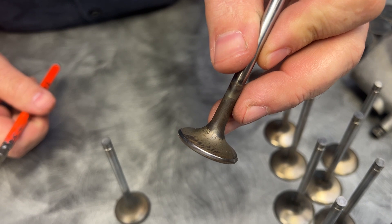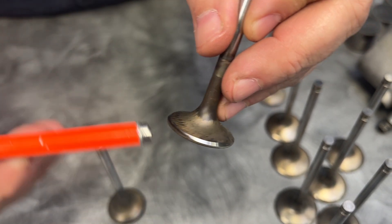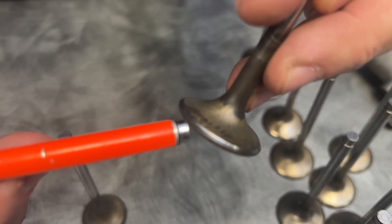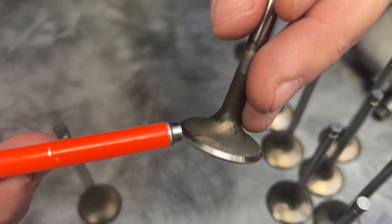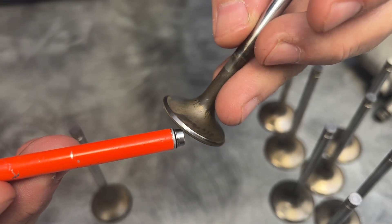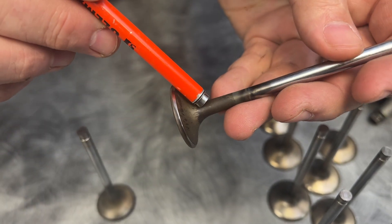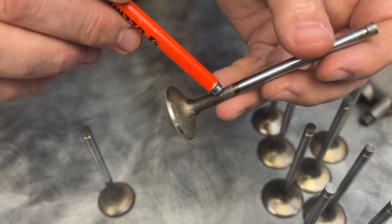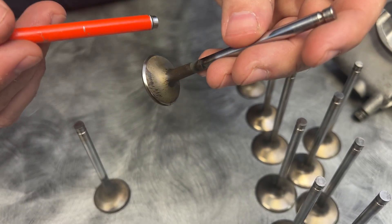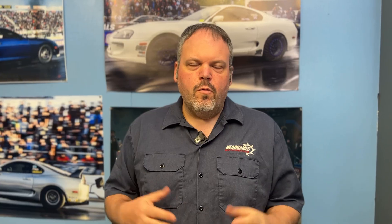What we had here was a bunch of bent exhaust valves. You can see here — I just re-faced this one so you can see how the color goes black right there. It goes silver, silver, silver, black. There was actually a bunch of these that were tweaked. We don't know because it doesn't really look like a lot of heat was in the stem. But when you start getting to this level, keeping an exhaust valve in it starts to become hard.